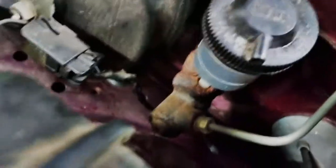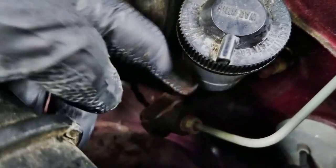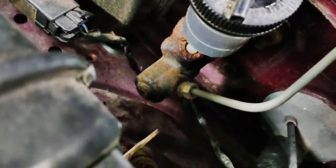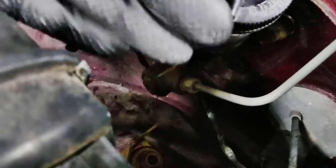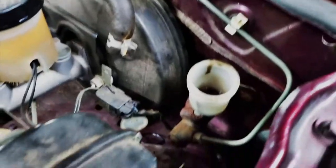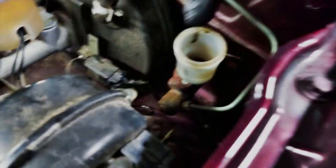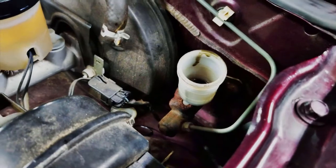Once you've done that, the inside is finished. With the inside loose, all we've got to do is take these two outer nuts off and remove this line, which is basically the same as a brake line — I would definitely recommend using a line wrench. Take those three off and then this should slide this way and up and out. I also recommend suctioning the fluid out of the reservoir before removing this and taking the line loose.